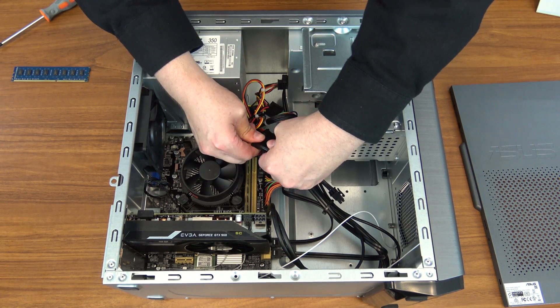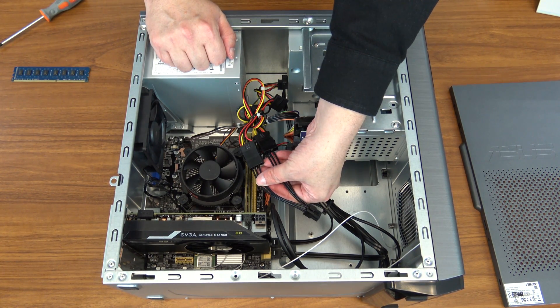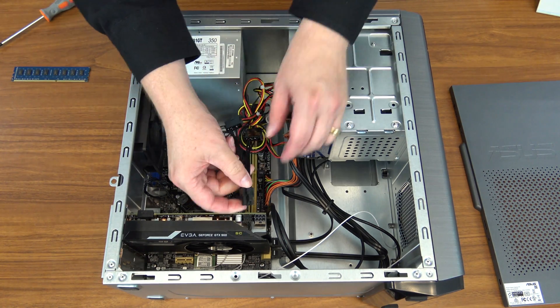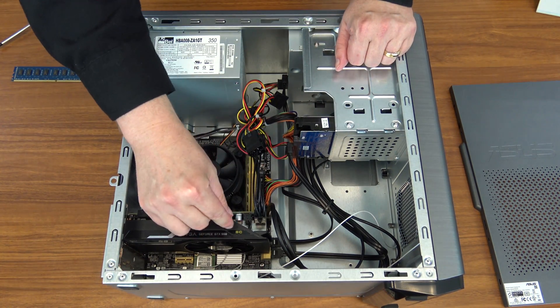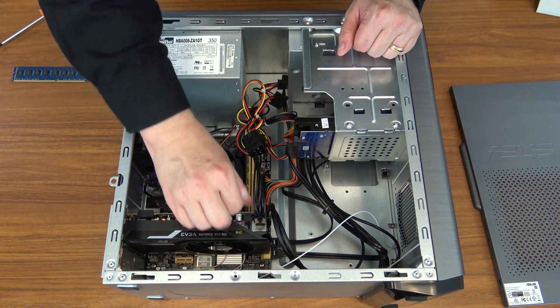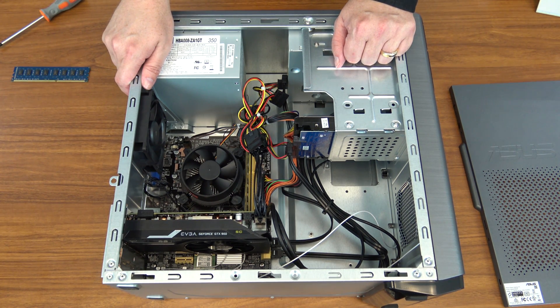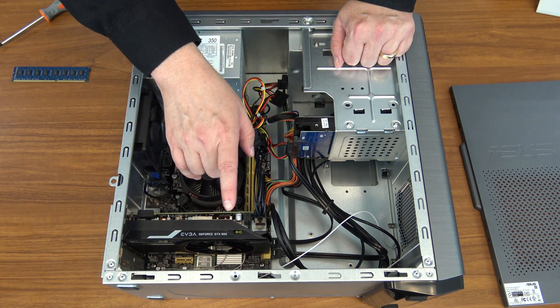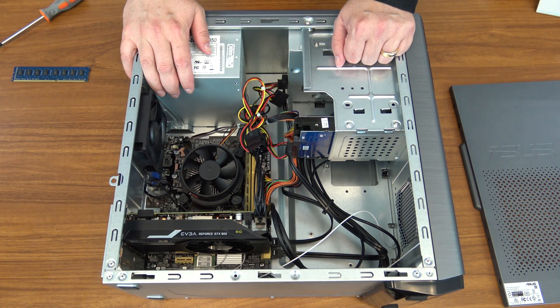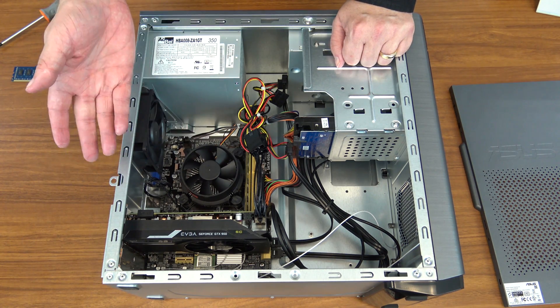These are very old school connectors — these connectors have been around for more than 20 years. They are beveled on one side so we simply line it up and insert one side in and then that one in. They can be a bit tricky to line the pins up. I've now got both of those fully inserted — basically just shove them in and make sure the pins are lined up. Then we take our 6-pin PCI Express power connector and insert it onto the graphics card. It should go all the way down with a click — and yes, that is clipped into place. We're done. Now we have power and this video card will work properly.